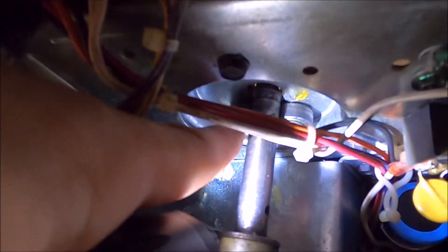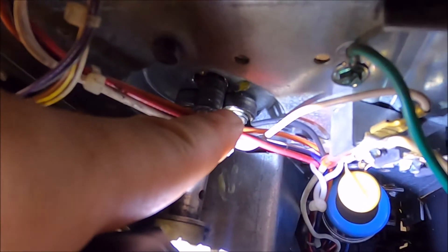So what I did — can you see the two bearings on there now? One there, one right there. I drilled two holes in it and I took a couple of bolts and a couple of bearings that I had sitting around, and I built a bearing surface for that shaft to ride on so it can spin as much as it wants to without shearing itself in half again.